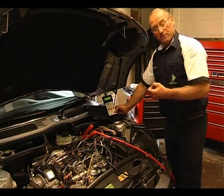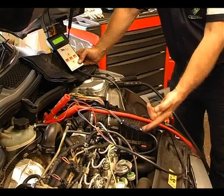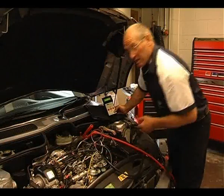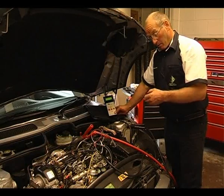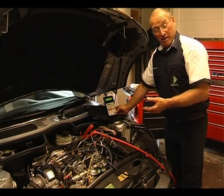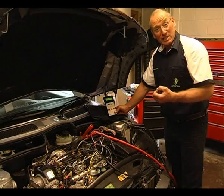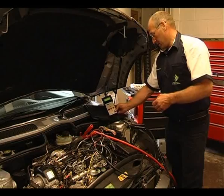We've proved that by a very simple connection using this tool, directly driving the pressure regulator and monitoring rail pressure via the sensor. We've actually disturbed very little in this system, but I'm able confidently to say now this pump is capable of building up 700 bar simply under a crank test using this tool. So that's a tightness test or a pump proof test.